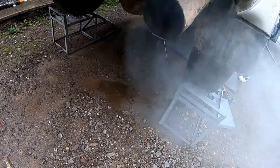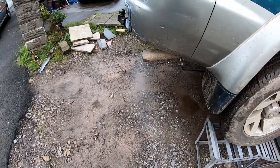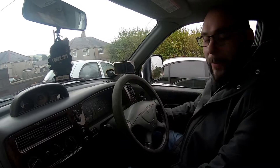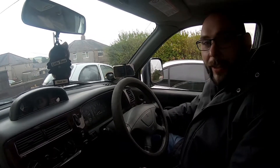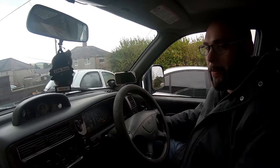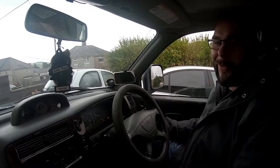I would have said that's been blowing for a while, just because of the amount of water that's coming out of that exhaust when you rev it — there's actually quite a steady stream of water. After every repair you've got to do the most important thing: back in two-wheel drive, and that is the road test — the fun part. Because this thing was hideously slow before we did the exhaust; it was like driving a milk float when I limped it back home. Hopefully it'll have a bit more power underfoot again. It sounds so much better.